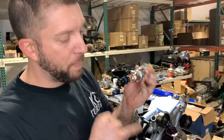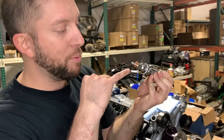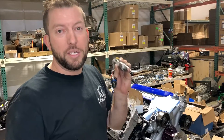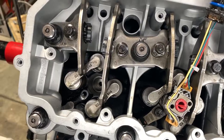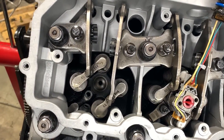Something to notice — that is the copper washer. You want that copper washer to be on there. If it is not on there, you need to make sure that you get one. If you get them from Warren, they should always come with them. Make sure there's not a copper washer down inside the injector cup. You don't want to double stack those.